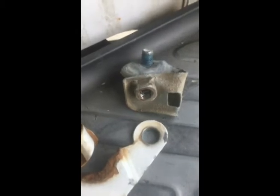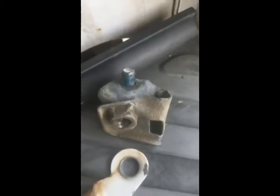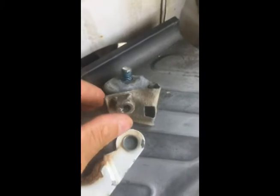When I went to remove the hinge point, it basically locked up inside the fender weld, and that's where I'm at right now. I'm going to have to go back and basically use a Dremel tool to cut it off. That's basically the nut plate behind it. When I went to unscrew it, it started going into a bind, and then it just went horribly wrong.